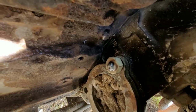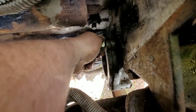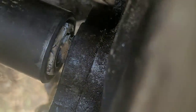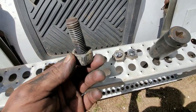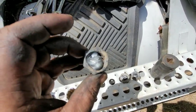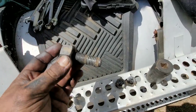It's not the best because it's off the generator, but it might work. I'm gonna try taking it off now. First one didn't work, so try again. Third time's a charm. See, the problem was these ones were too small and I didn't have enough area on the inside to weld to the stud or to the broken nut or bolt. So that was the only way to get it was a really big nut and then weld the crap out of it. And then it finally did it and it backed out.